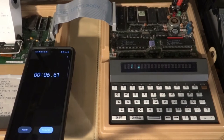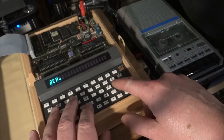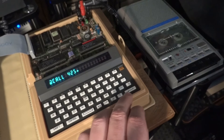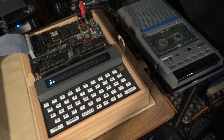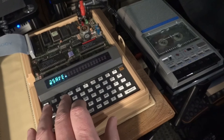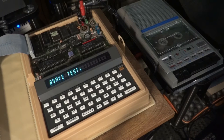Only six seconds! Makes quite a difference. Now that the program is working nicely, we want to save it to tape. Before doing that, it's important to disable the keypad beeps — otherwise you'll be recording the beeps to tape as well, which might make it difficult to restore the program later since there's no motor control.